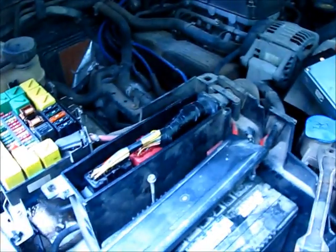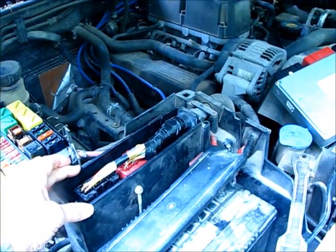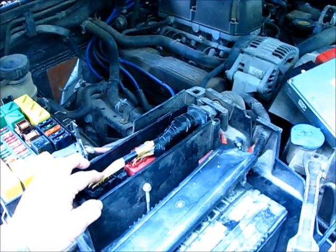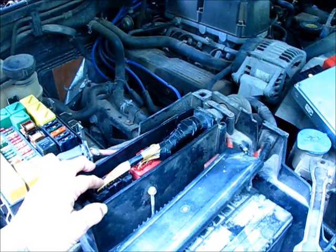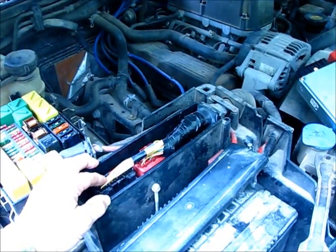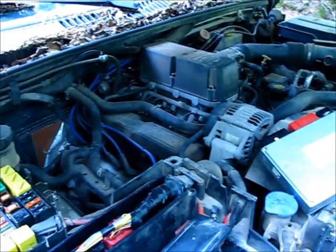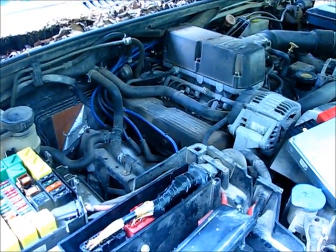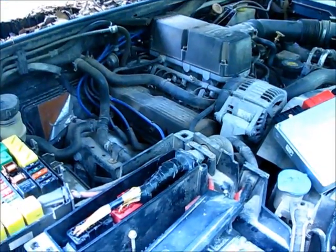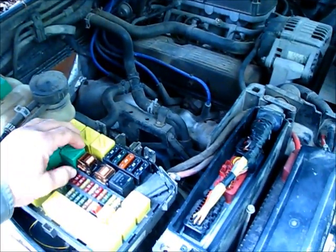As I mentioned in my post, I had to spend $1,000. I got a British hacker over in London to hack into this, and they were able to basically unlock the unit — to allow it to function in a standalone mode, so that it would run the engine without what's called the BECM computer that's under the passenger seat needing to synchronize with it. And it's just amazing to me that when all is said and done, this is what it amounts to.